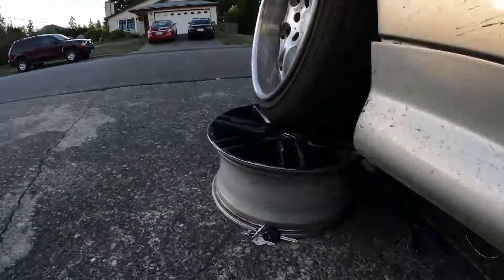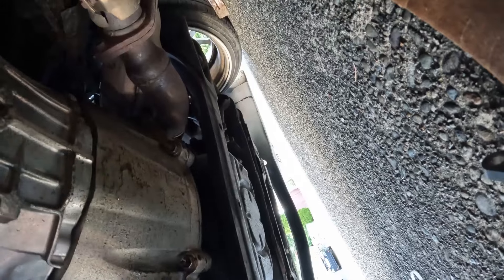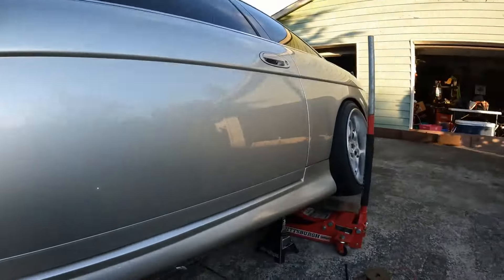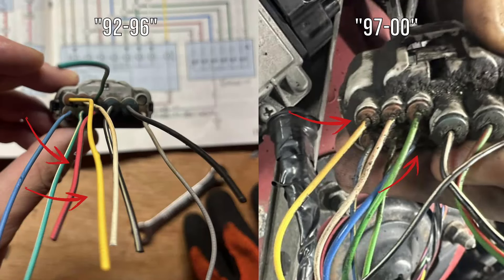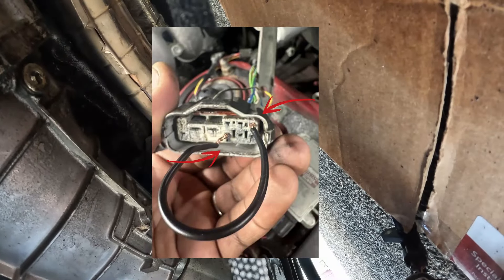Time to check for the reverse wire — blue. I see blue and yellow. There's a full blue one and a blue-and-yellow one. According to a comment from Max that I read a couple weeks ago, this plug should be the same orientation no matter the color. So if we just cut some wire and shove it in there, it should light up — top right this one and bottom left in the middle.